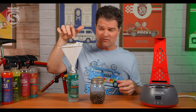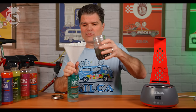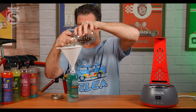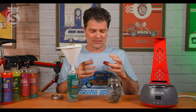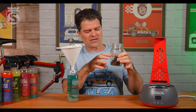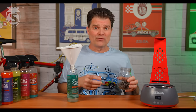It's as simple as stuffing a cheap coffee filter into a cheap grocery store funnel and pouring the used stripper through it. We'll pull this in a minute and you'll be able to see all that lifted and encapsulated solvent — the grease residue — on the filter, and your bottle of chain stripper is back up almost completely full. Then we run two warm water rinses: about six ounces of warm water, shake, dump it out, then six more ounces of warm water, shake. Two rinses of warm water — eight ounces is fine, just don't skimp. Pour it out, and then we're ready to go on the hook and back in the wax.